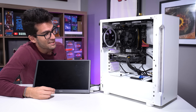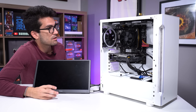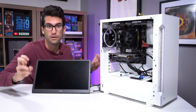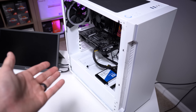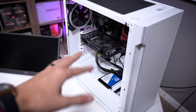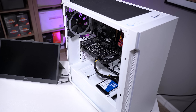Maybe a dead motherboard — who knows? We're going to check the obvious stuff first and work our way down to the worst case scenario, which would be a dead major component. The power button is lit up, so I believe the system is receiving power — it's just not booting up. That again could lead me to either a simple wiring conclusion or a dead component.